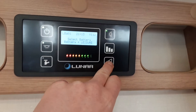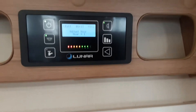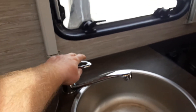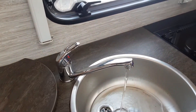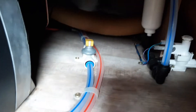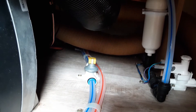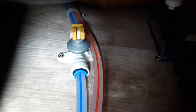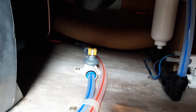You've got an arrow here that allows you to go through the different options on board the caravan, and also set the time, which we'll just set now. So once you've got the control panel turned on and it's ready to go, we'll go to every tap on board the caravan and open them all up on the hot side of the water system so we can start bleeding the water system. I've already filled the system up so there's already water in it, but you'll go to every tap and open them all up on the hot side. You'll then come underneath the seat on the front right-hand side of the caravan and underneath here you will find your yellow drain-down valve. That yellow drain-down valve is to fill and drain down the water system on board the caravan — it does as it says on the tin.